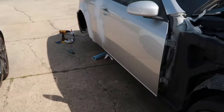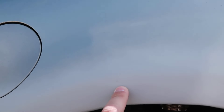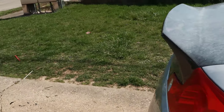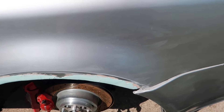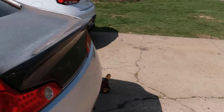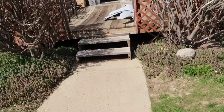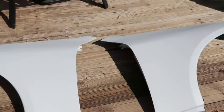Alright guys, we're back another day. I went ahead and primed all this stuff — this whole side. Doesn't look too horrible. It has its spots here and there, so I'm going to go ahead and use some spot putty that I'll put on there, wait for it to dry, and then it should fill them up for the most part. I still have the other side to sand, but I probably won't bore you guys with it. Also, I did prime the fenders — they're over here. They look way better now.